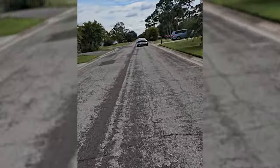I don't know, probably just needs a better pan. I knocked a dent down in the bottom so it has more clearance from the filter, because sometimes it'll suck to the bottom, which is no bueno. So when I dented it, it might have malformed the pan probably, so it's got a little tranny leak right now out of the gasket. Believe it or not, brand new gasket.